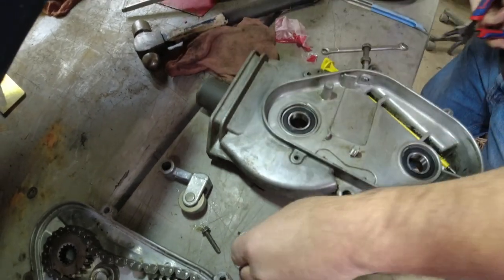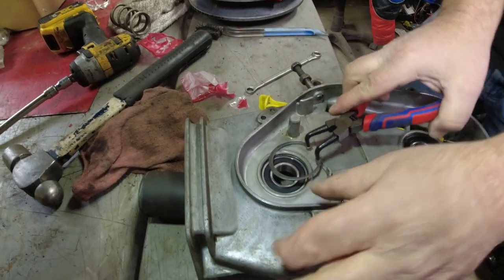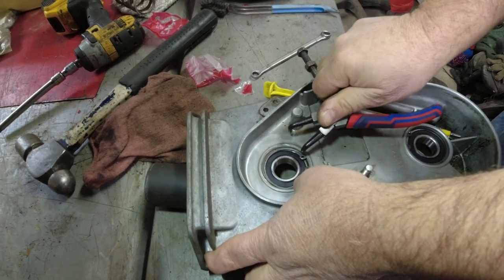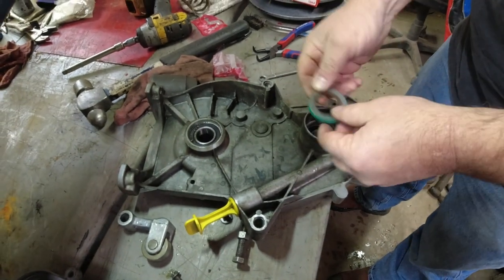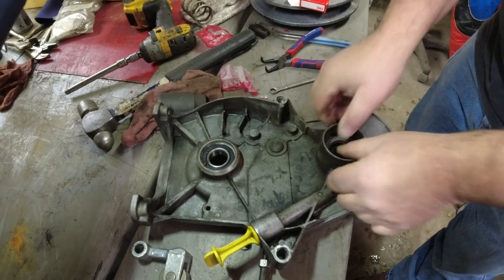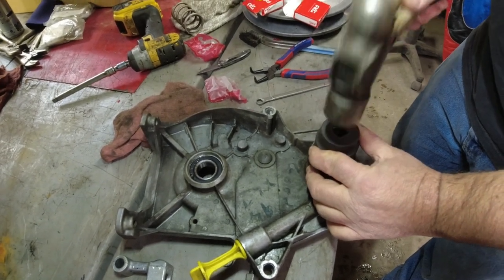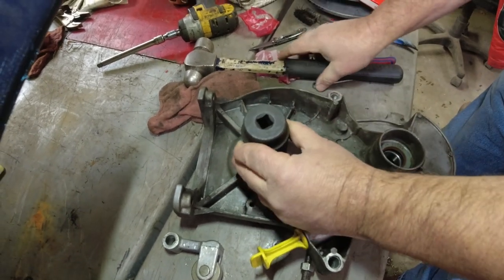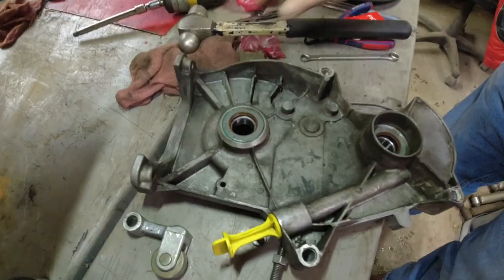She's home. Don't be afraid to hit too hard because these castings are strong — do what you got to do. Snap — that's what we call a snap ring. Seals. I've got some nice seals right here — genuine Polaris seals, load stock. That's home. You just got to kind of do it by feel a little bit. Same part number. Seals top and bottom. We'll add a little white lithium and bolt up this chain case.